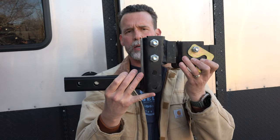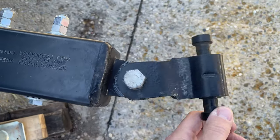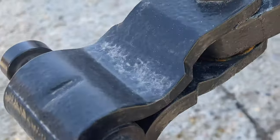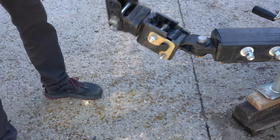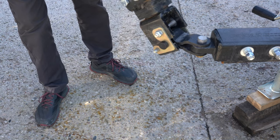Here's how it goes on the truck. I needed to jack up the height of it because the suspension on the trailer has been raised, so when I towed it before the trailer was tilted forward. On this trip I didn't disconnect the trailer much, so it was nice to have it ride flat — when we pulled into a place to stay for the night I didn't have to worry about adjusting it. How the Lock and Roll system works: this is the new coupler on the trailer, it has a heavy-duty bolt and allows it to swivel. I back up the truck, lower the trailer down, and line up the two bolts with the attachment in the hitch. Because it rotates, even if the truck is a little off I can rotate it in and align the bolt fairly easily.